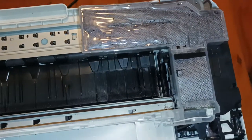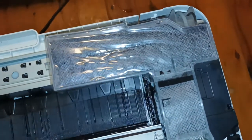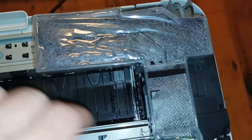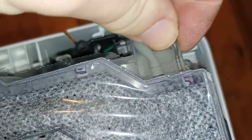So in this machine, the machine pumps the waste upwards. So this is the waste absorber here. Built into the waste absorber is the sponge that absorbs all the waste ink. And they have built into the cover, which is going to be very difficult to show on camera, but you'll see it when you pull your printer apart, there are holes. So on this machine, the ink gets pumped into here and here,